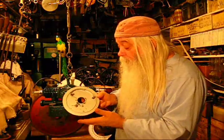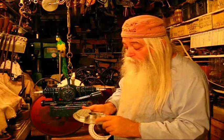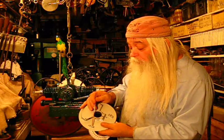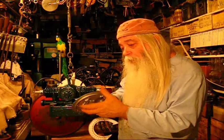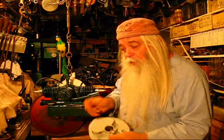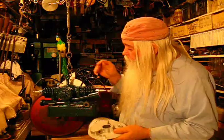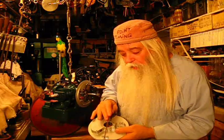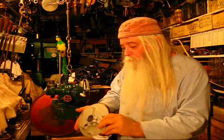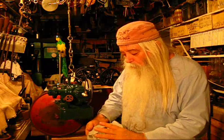What we're observing in this episode is that the timing on a 72 is fixed — you don't have a choice. In the back here it's got this little notch, a cutout. It's identical on all of them. I have bought these engines in the past where that notch would be sawed in two because the operator wanted to rotate it to change the timing. Most of them just break one off so they can rotate the timing, but that notch is there to align this backing plate to the boss on the back of the engine. You cannot go wrong — just put that in that little notch, snug it down, and slide it in as far as it'll go. No gap between this and the housing.